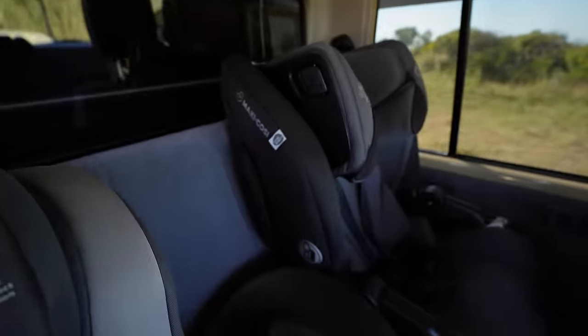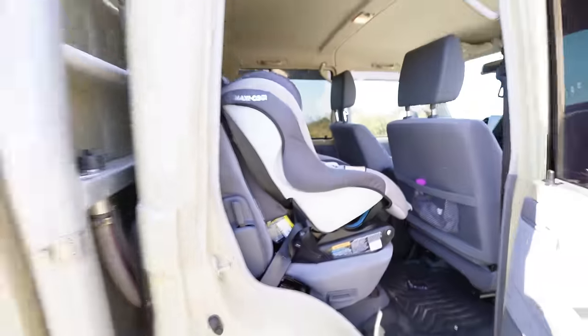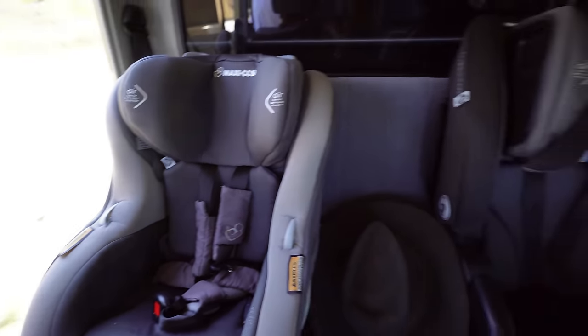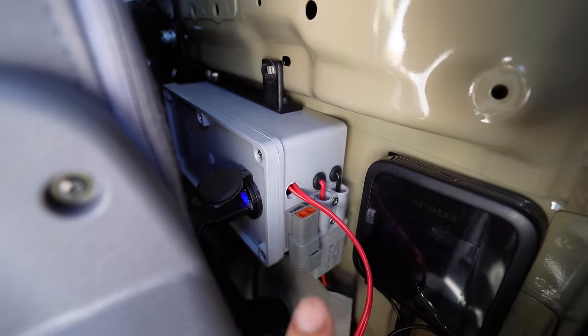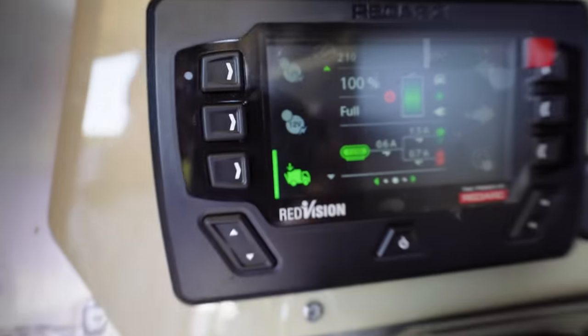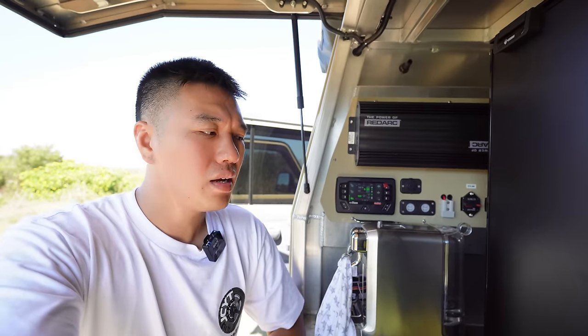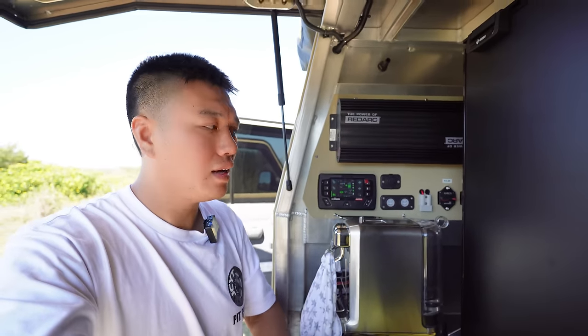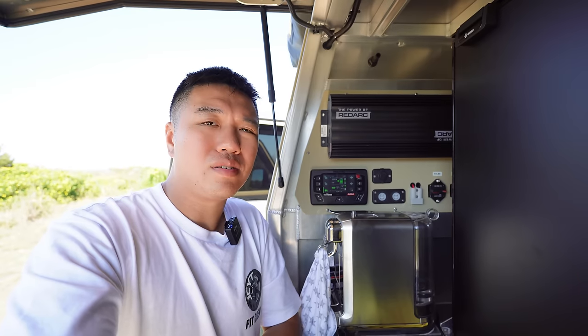The second row — with two baby seats in the back there's not much room for anything else. I understand this is not designed for a family, but a lot of people are buying these cars for work and recreation. It does feel quite claustrophobic at times with four people in the car, but something you get used to pretty quickly. Back here, tucked behind the seat, is a 30-amp circuit coming from the second battery — mounted to the rear wall. I've used another fuse box to distribute the loads, and it provides constant power to the dash cam, the internet modem, and the USB sockets in the car. That's limited to 30 amps at the moment. If I really wanted to, I could grab another 30-amp circuit from the TVMS and it would give us a combined 60 amps in the cabin, but at this point I don't see it being necessary.